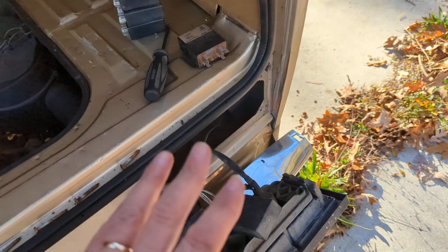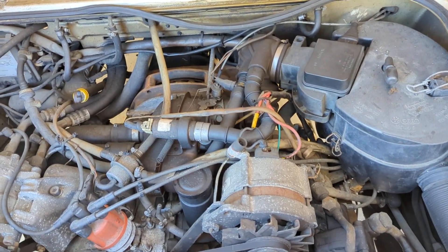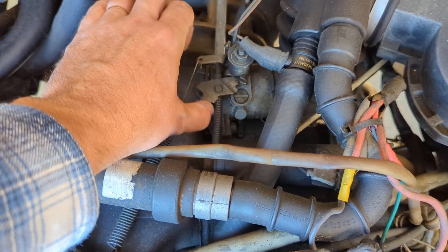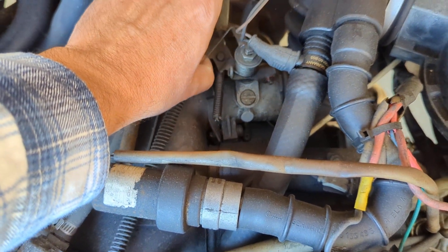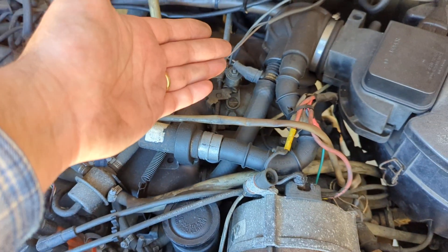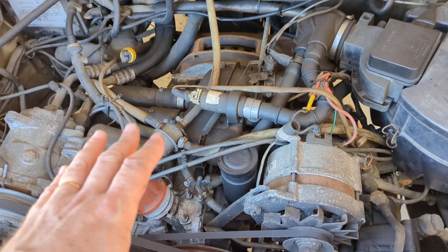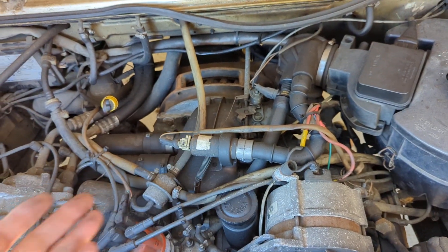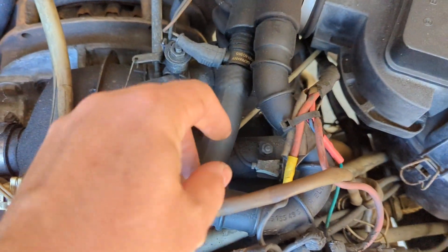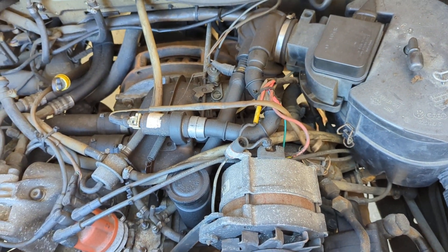So why would you be interested in this? People have issues with the idle fluctuating up and down. Normally, my first check would be to check the throttle position switch on your throttle. You can hear a little clicking noise when it's at idle and also at full throttle — that's what you want to hear at idle position. That is sending a signal to this unit that it's at idle and it will stabilize the idle. If that is clicking, then I may do an electrical test on it. There's a plug right here — you can unplug the fuel injection connector and test it electrically with a meter to see if it's working.